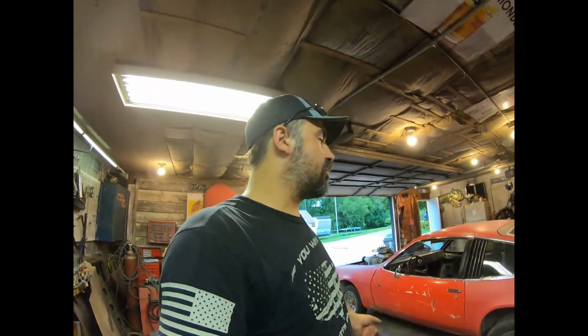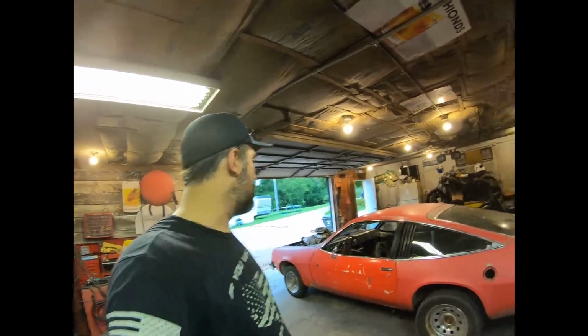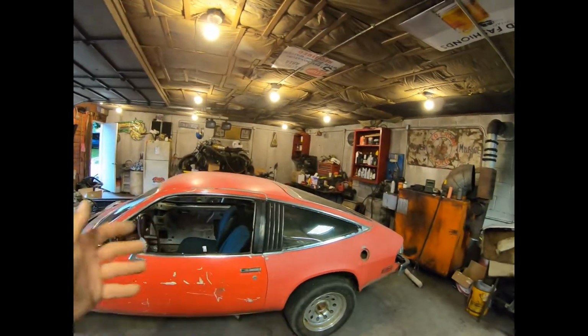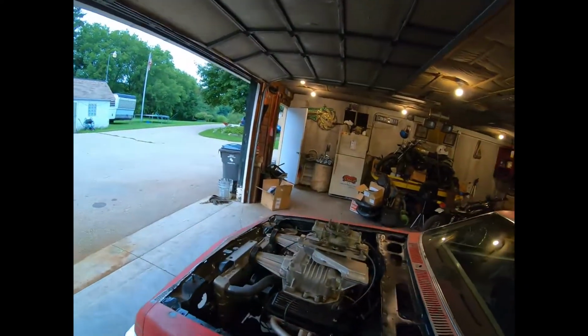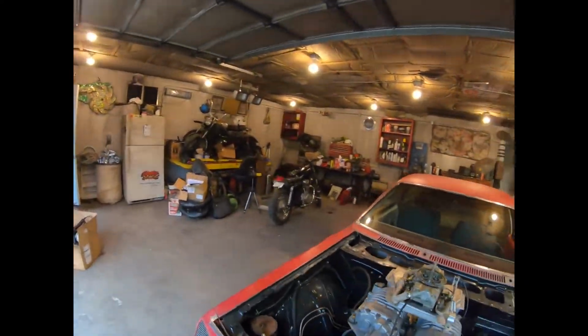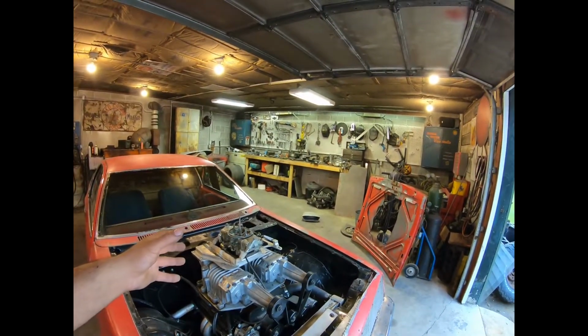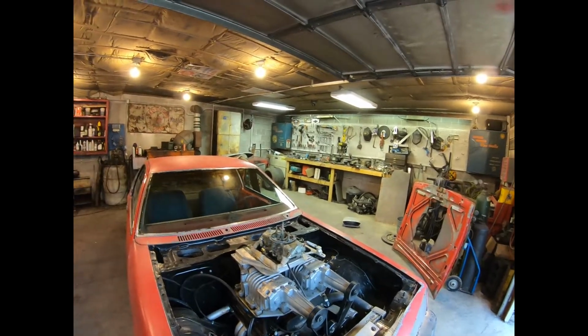Light it up, go out onto the track, whip 3 donuts, and bah, dies out of fuel. Sucked the bowls right dry on the carburetor. I have 3/8 fuel line running from the front to back, welded into the tank. And the only two things I can think of, well, number one, I guess I really didn't consider the fuel system before we went. I really should have. I guess I didn't know that this was going to draw that much. I probably should have. It's pushing a lot of boost.